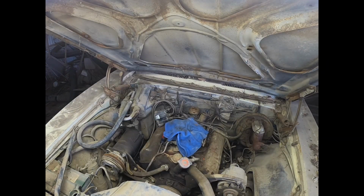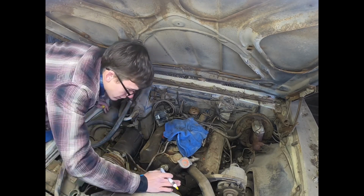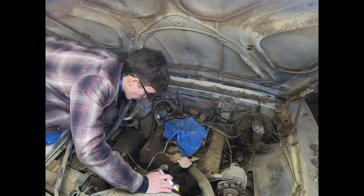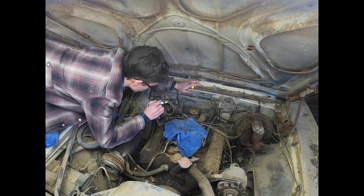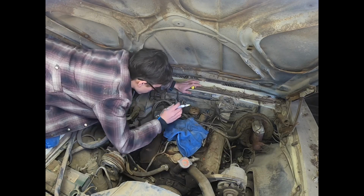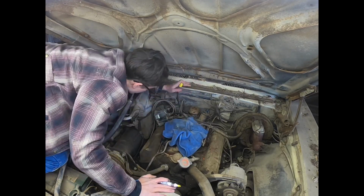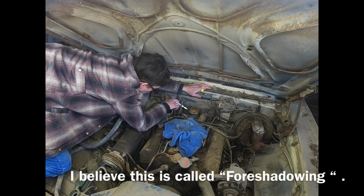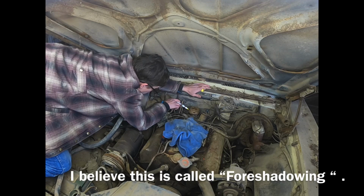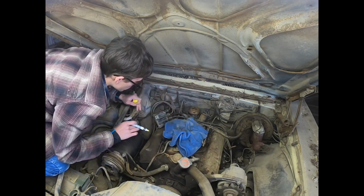Another thing that I'm going to do before I pull the distributor is I'm going to attempt to do it without having to reset the motor at top dead center. I'm going to hopefully try and mark everything with a yellow marker, which there's not a lot of room in here compared to my truck, so if we have to, I've done it before exactly twice, so that won't take but 3 or 4 days to get done. Yeah. Alright, I'm not allowed to move the motor anymore.